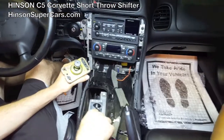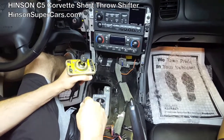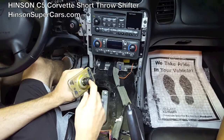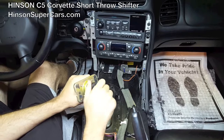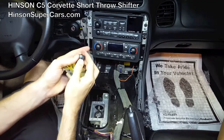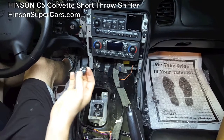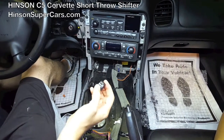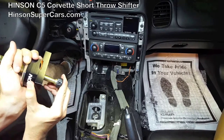With the C5 base shift box surface area cleaned, we've got the bottom of the stock handle. We do need the plastic grommet off the bottom of it. This just pries off, so with a little bit of effort you can simply push it off the side. There's no fluid inside here. There's a little bit of grease still on the bottom of the ball. If yours is perfectly dry, you may want to consider putting some more on there.